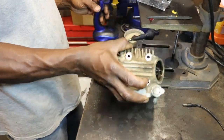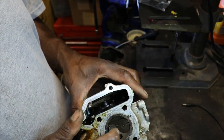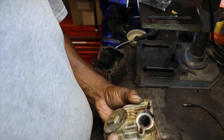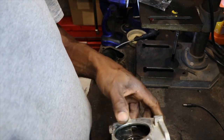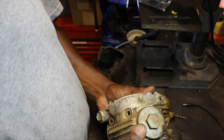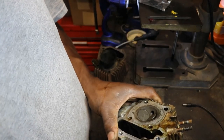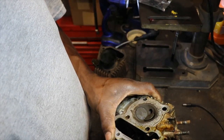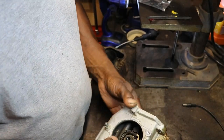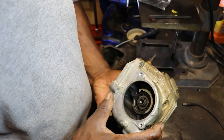We got the head, and this valve is stuck open. So in order to get the rocker shaft out of there, it's got two pins down in these holes right here that the rocker shaft is on. I can spin the cam. It's definitely hitting something. I think it's just hitting the exhaust valve. But we have to get these pins out, and I don't know if you can tap on it and they come out, or...